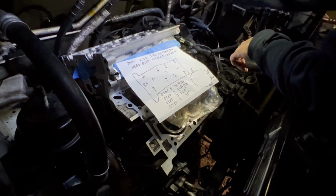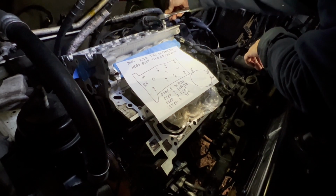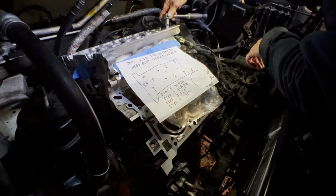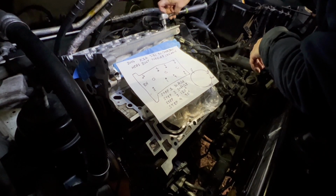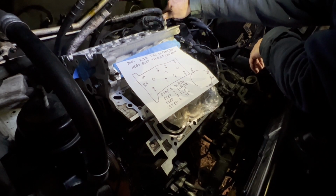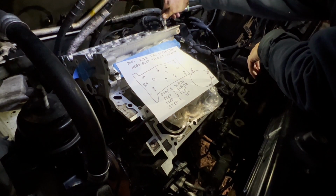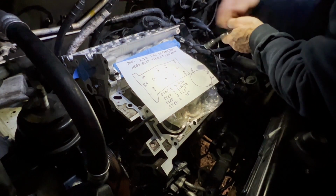Okay, I'm running the head bolts in by hand. This is the last one, and I just wanted to show you something. Kind of do it like this. Hold the ratchet like this, or I even have a very short-handled 3/8, but you basically want to just, when it stops, that's when you stop, okay? Just hand tighten them. Here's the sequence.